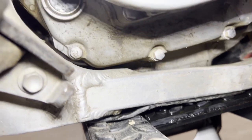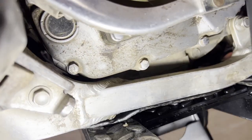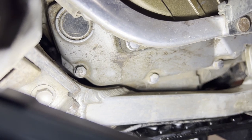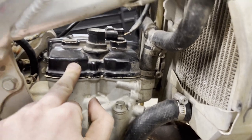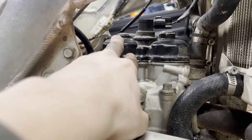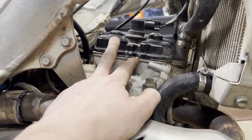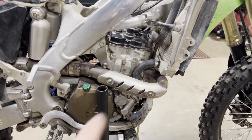Taking a look at the sight glass - there is some oil in there, not a whole lot, but there is some. You can see the minimum and maximum lines - we're sitting a little bit below the minimum line. That's a good thing that there's oil in it. I'm going to go ahead and start pulling this valve cover off and see what our cams look like. If the cams end up being super worn out, I'd start from the top down - valve cover, cams, then the head - and see what we've got on the rod.